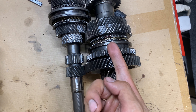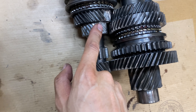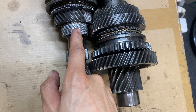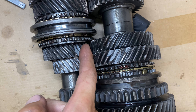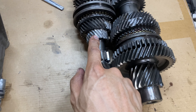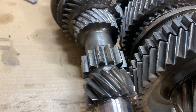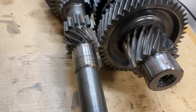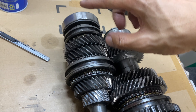Here's a closer look at the main and counter shaft. Right here, this is second gear, and second gear is completely gone all the way around. Right above it is third gear — you can see we're missing some chunks right there. I'm not sure if I can fix this. I think I have to replace this whole shaft, because second gear looks like it's part of the shaft — you can't just replace it. I believe that's how first, reverse, and second are, but the rest could come off.